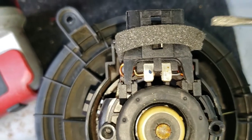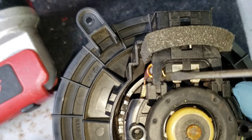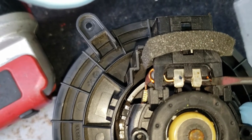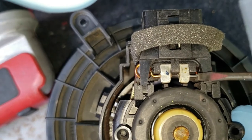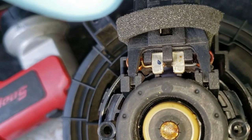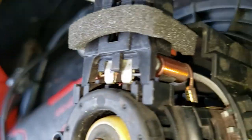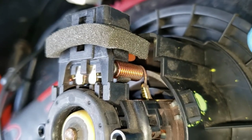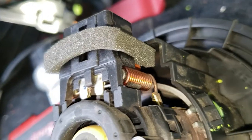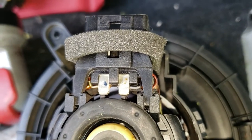If you look at these two connectors — this one here looks nice and clean with a nice coppery wire. This one over here, part of it looks pretty clean, but this wire is gray. If you look back, it's discolored and has... it's actually burnt the surface off, it's got an oxide on it. You can see the color of the wire going around in the choke coil is a nice coppery color — that's with the varnish insulation on it. But that one top little strand, you can tell the varnish has been burnt off right there at the end and is discolored.